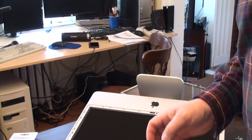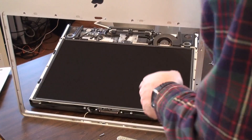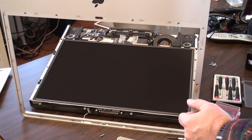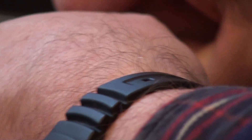Now we're ready to take this off and start pulling. The only thing to worry about is the camera and microphone connector are right there. We can undo that so we don't yank on the wires. It's a little hard to get the tape off, so I'm going to use just a plain old regular knife and cut this tape that they put in at the manufacturing plant. They put this tape all around it — make sure you don't cut any wires.